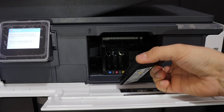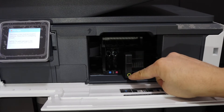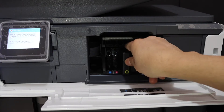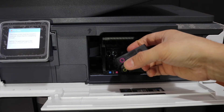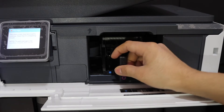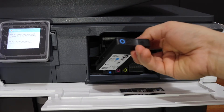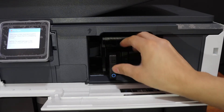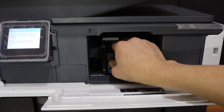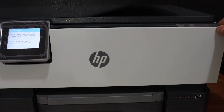Now the yellow cartridge — with the seal and marking facing outside, the seal should face downward, and push it in. The round seal, which looks like a ring-like structure, faces down. Push it in. For the blue, that is the last color — place it in, and once it slides in just push it in and it will lock. Now close the ink cartridge chamber door and go to the main screen.